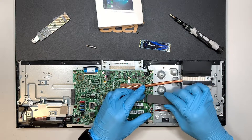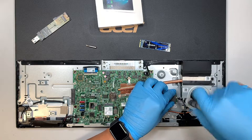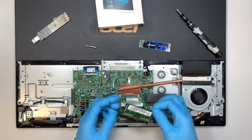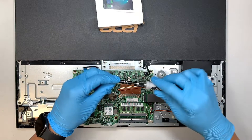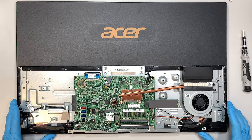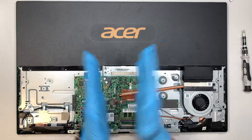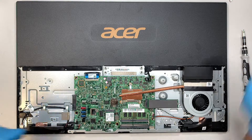That's all I wanted to share with you, so you get an idea of what you want to do with your Acer computer. For installing the RAM, you don't have to do any settings — just install the additional RAM and the computer will recognize it automatically. For the M.2, you'll need to either do a fresh install or clone the drive over. Check out the links in the description below — I'll include a tutorial on how to clone. Thanks for watching. If you find this video helpful, please give me a like, subscribe to the channel, and comment below if you have any questions about this computer.